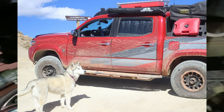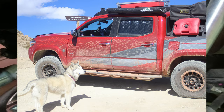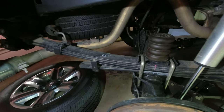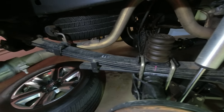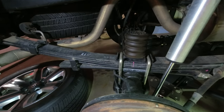But the add-a-leaf spring really isn't designed for all the movement it gets. They're more brittle from what I understand and they'll eventually break if you rely on them to carry all that weight when you're off-roading. They're more made for trailers and stuff.